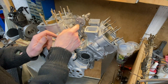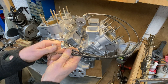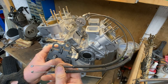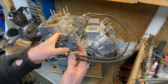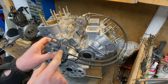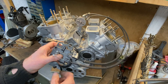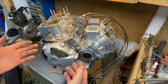The two cables are now connected. Pulling them simulates what the servo does - you can see how it will work. On the servo there is a pulley - unfortunately this one has been robbed for another reason - but there's a 1 and 2 marked on the servo and a 1 and 2 on the cables, so at least you get told which goes where. The only slight snag is one cable is longer than the other. Sod's law says you'll get it wrong first time, so whatever you think of doing first, don't do that - do the other thing. That's how the power valve system works on an RD500.